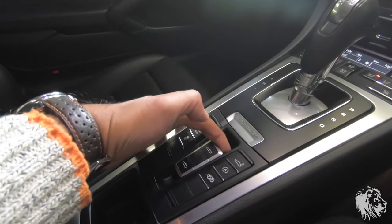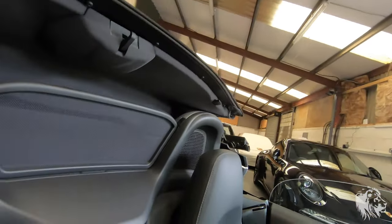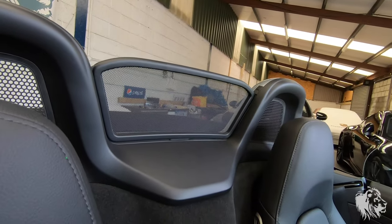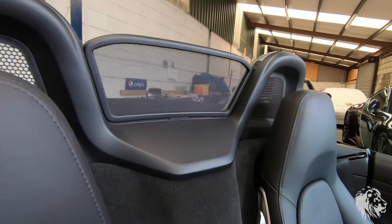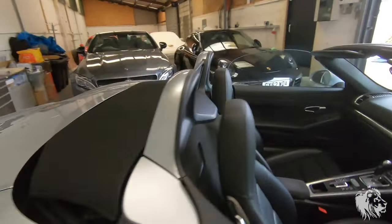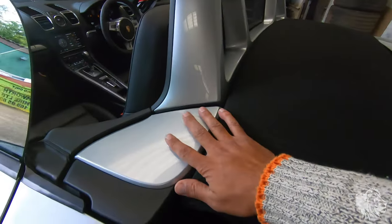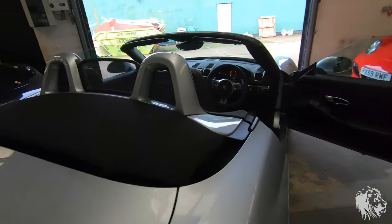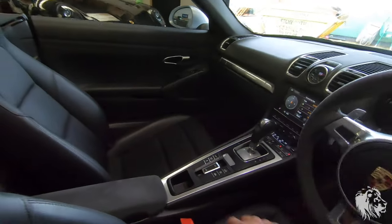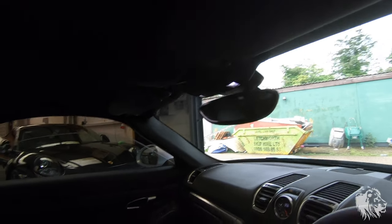To operate these buttons you don't push them in — you pull them towards you. So I pull this one towards me and hold it up, and it will lower the windows, then disengage that little electric clamp at the front. Older generation cars — 986 had a manual hook, and 987 gen 1 and gen 2 had a hook there too. It's lowered the hood and raised the windows back up, so that's it fully open. To close it, you repeat the same exercise with the other button — it drops the windows, opens the flaps, brings it forward, the clip meets its socket, and then the windows raise on both sides.